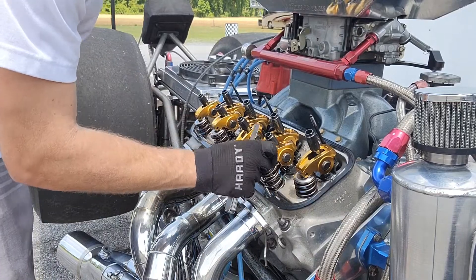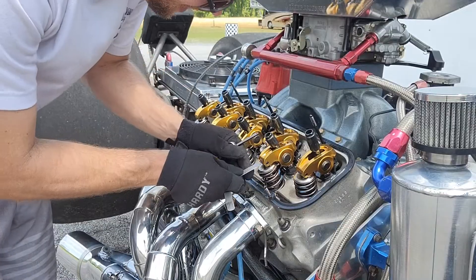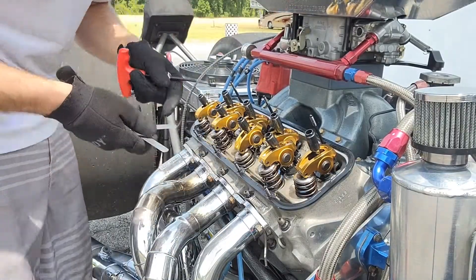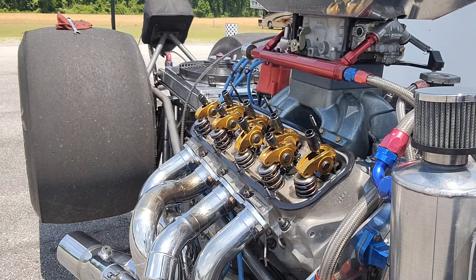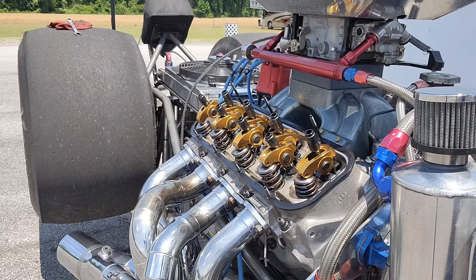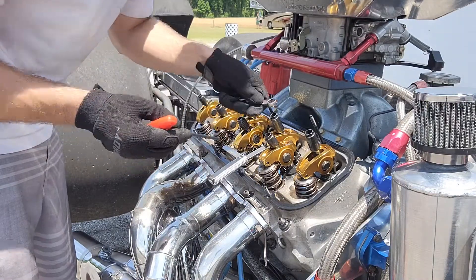The intake is starting to close, we're loose on the exhaust valve, so let's do that one at 26 thousandths. That's fairly snug already — I'm going to leave that one alone. On to the next one. Exhaust opening, intake closing — we're looking at number four now. Exhaust starting to open, so we're going to do the intake. 24 thousandths — that one could use a little snugging up.